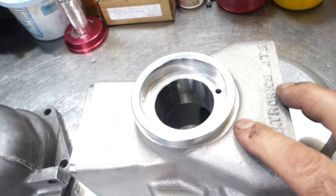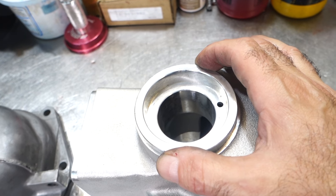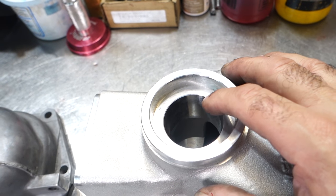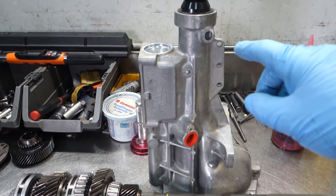As far as bushing and seals go, I utilized a bore for the Chrysler Hemi since it's a very strong setup. So this transmission actually uses a Chrysler Hemi rear seal and bushing. That allowed me to create a yoke with a very thick wall for racing so it would never shatter. I went with a 28-spline main shaft so I could use existing Mustang fifth speed gears, which are very common — the Jeep main shaft was 23 splines and it's very oddball. There aren't enough fifth gear ratios with 23 splines, but there's a lot for 28 spline ratios, so it made more sense to create a shortened 28-spline main shaft for this platform.